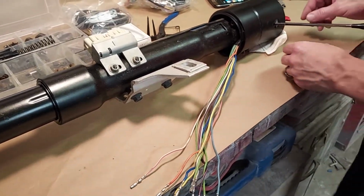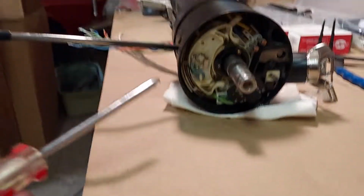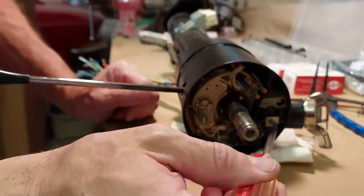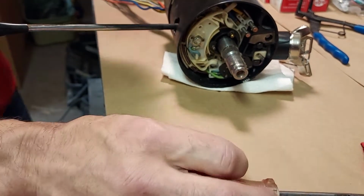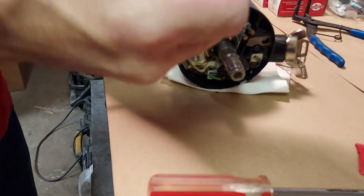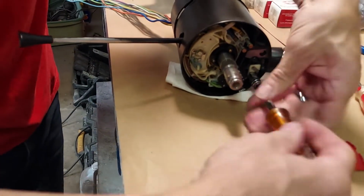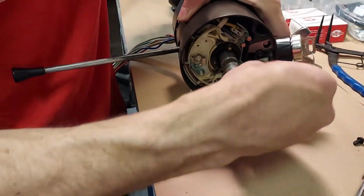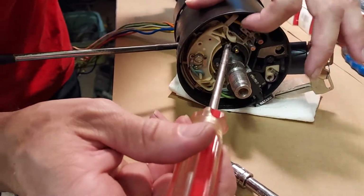All right, the next step, Christina, if you want to come over here. There's 2 screws that hold this switch in and 1 bolt. I told you about the black and red wire that has a key buzzer. That's the key buzzer sensor. So that is a 1/4 inch socket. I'll get that one out. And then the 2 screws are behind.